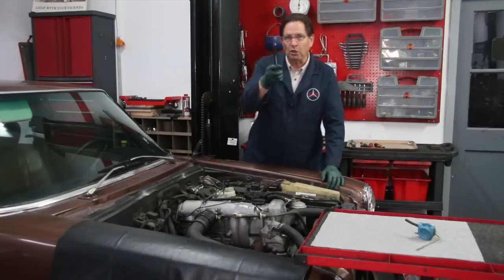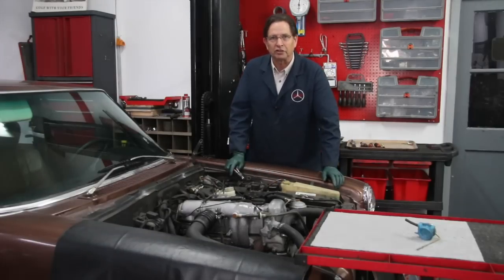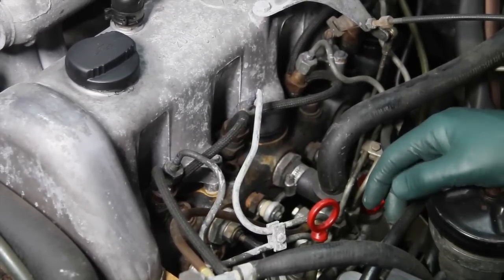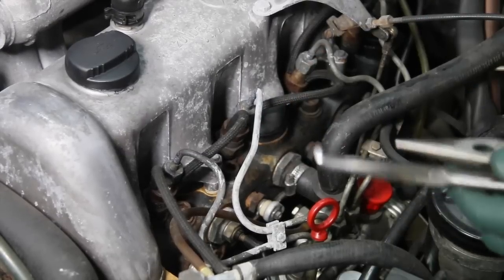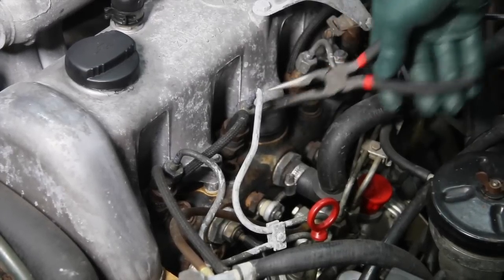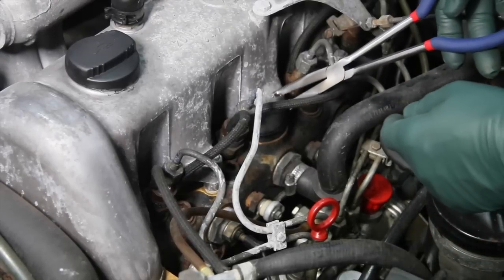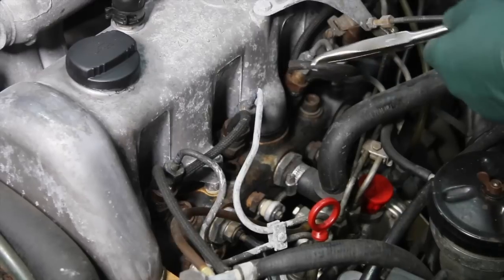I'm going to move the camera in close and show you how this works on this old 240D here. I'm going to start removing these fuel injectors and I have to remove the return hoses first. If you've worked on these old diesels before, you've probably already found your own technique to get these hoses off. It's really tough to get them off without damaging them. You can't pull on them because the more you pull, the tighter they get on that nipple at the top of the fuel injector. If you try to use needle nose pliers or regular pliers, you squeeze it enough to get it off but end up damaging the hose internally. So what I wanted to do is come up with a tool that will allow me to grab onto the hose right down close to the nipple and twist it like this. Then if I twist it and get it loose, I can just pull it off just like that.